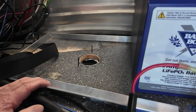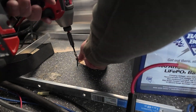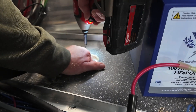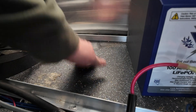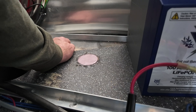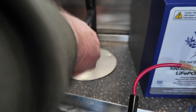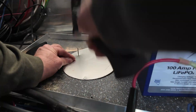But we do have to address this hole. That white board there is actually a five-gallon paint stir stick that I got from Lowe's or Home Depot, and those are just two drywall screws I'm using to hold it in place. It doesn't have to do anything other than keep this insulation plug that I'm going to insert from falling through. That is just a three-quarter inch high-density foam that I got at Home Depot. Next, I'm going to cover this with an aluminum disc — I bought a sheet of aluminum from my local Airstream dealer that was 12 inches by three feet, and I used my jigsaw with that thin metal cutting blade to cut it out. Might be overkill — nobody's ever going to walk on it — but it just seemed appropriate.